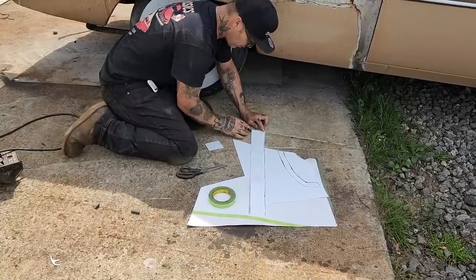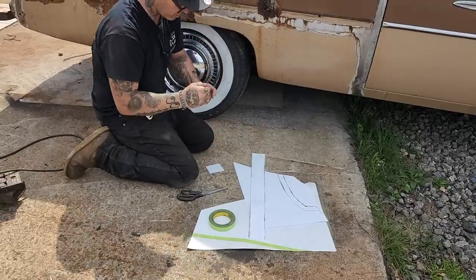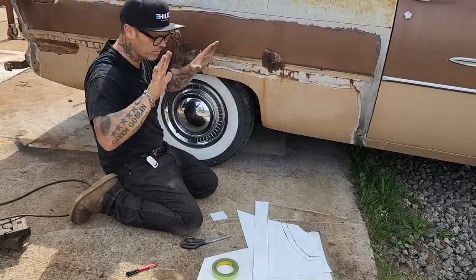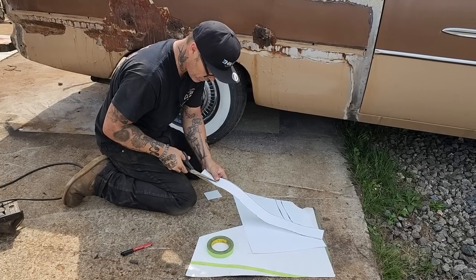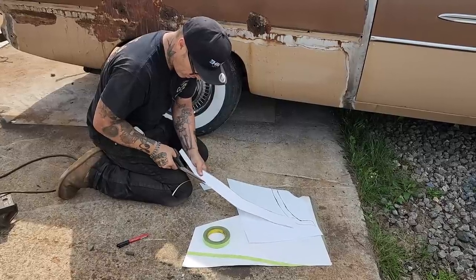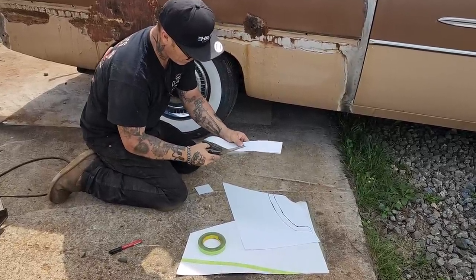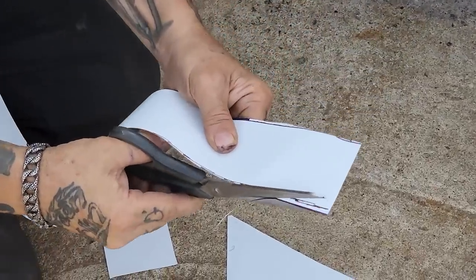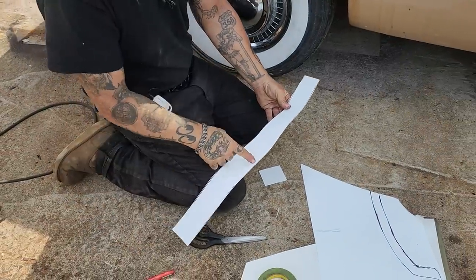just a little bit here. And the only reason I'm taking that off without knowing what I'm doing is because I do not want that quarter panel exactly flat right across there. I want a little bit of, what is that called? A little bit of contour or shape, that it's got a high, and we want the high in the center. So I'm just going to knock a little bit of this off. So now the high is in the center. That's where the high is.